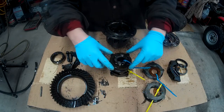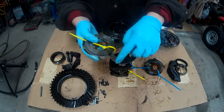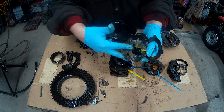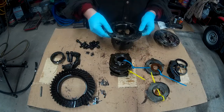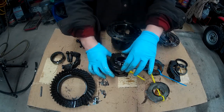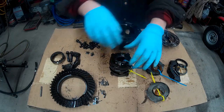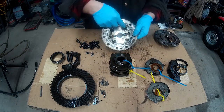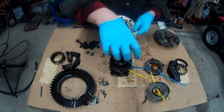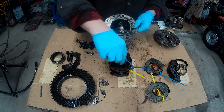You can see we've got those outer rings here, the outside set, and then we have our inside set in here. What that'll do is, because these planetary gears are locked into this housing, because in this housing we've got the grooves that fit for this, this system is locked. This does not move. But the gears, these two in here, can still freely move.